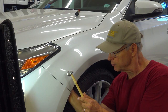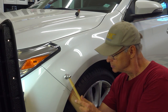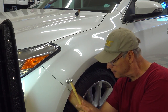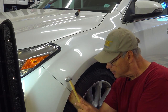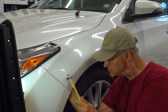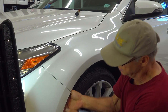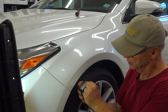It's called ironing out your panel. Toward the end there I rocked the dolly to the very edge so that it was in contact with the body line, put quite a bit of pressure on it, and helped to work out what little bit was left of the body line.